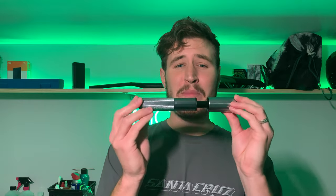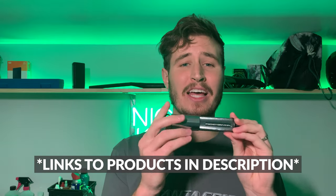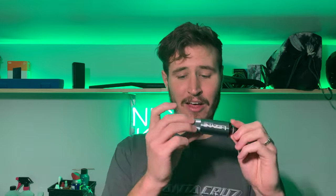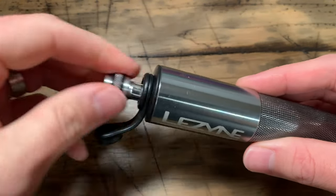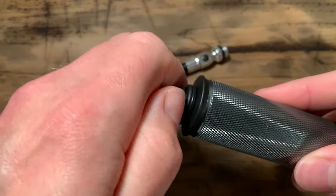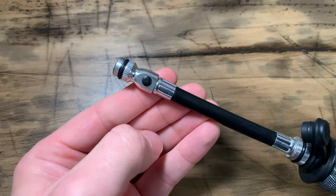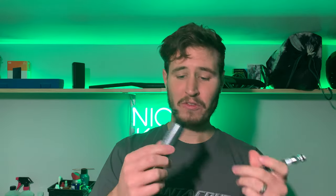The next thing on the list is a mini pump. You can carry a CO2 inflator and CO2 - it is arguably more compact and small than this. However, I like the practicality of using a mini pump. This is the Pocket Drive HV by Lezyne, and by the way all these products are going to be linked down below in the description. This Lezyne Pocket Drive HV, which stands for high volume, is pretty cool - you pop off this end, twist this out, and it unleashes a little tube that you pop into the other end, which is protected by a seal. It has Presta and Schrader on either side as well as a pressure relief valve for fine tuning, and it puts out a pretty decent volume of air. It's super lightweight, feels very solid and sturdy.